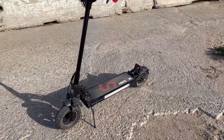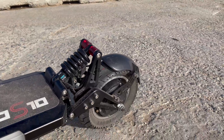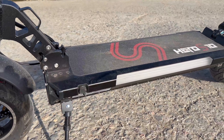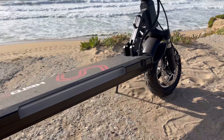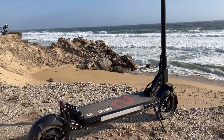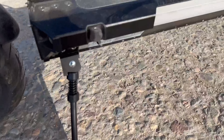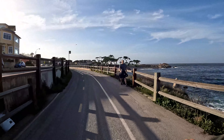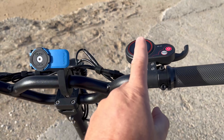Let's talk about power before speed. The S10 does have a 1000-watt motor in the rear wheel, and that peaks at 1300 watts — which ties in size with the e-move cruiser as far as power. That is powered by a 52-volt, 23 amp-hour, what they call electric car grade DMEGC cells. The battery is rated up to 800 charge cycles. There are dual ports — it only comes with one charger, but you can pick up another. It does take six hours to recharge.